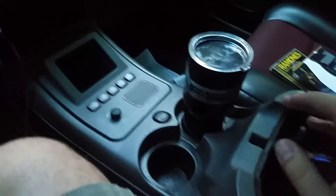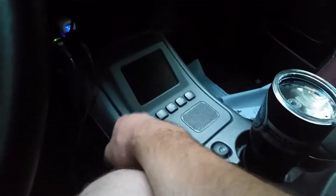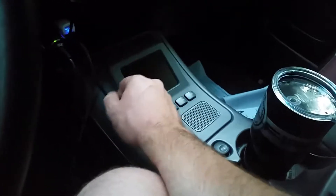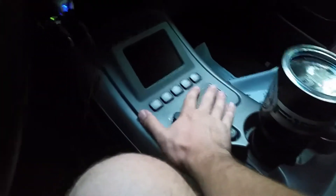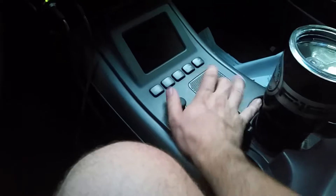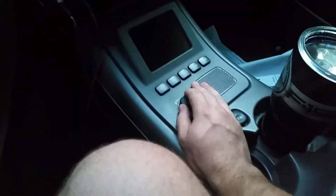I've done a few tests. I thought the screen was bad — that was my first thought — so I ordered a new one, but that didn't do anything. I was able to test it and found that the backlight for this one and the old screen do work. Then I thought it was this unit itself, because there is a certain board in here for the buttons, the knob, the speaker, and sending all the data. Got a new one of those — that didn't fix it either.